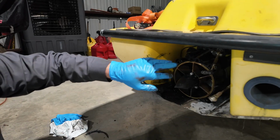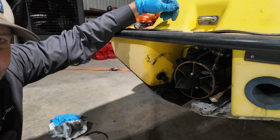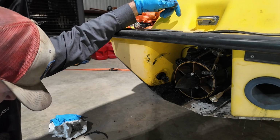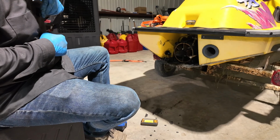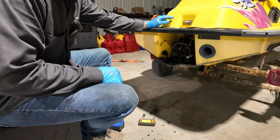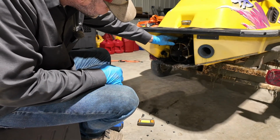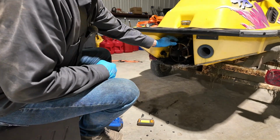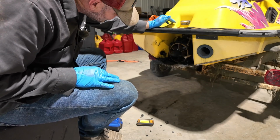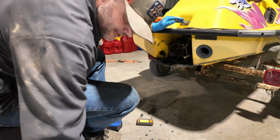I'm gonna go ahead, look at the shaft, make sure it's in the right position, check my 3 hoses, and then just start bolting this thing back down. So give me a minute and I'll reposition the camera. Check the shaft, totally engaged, first shot. Could not believe it. The 3 hoses that hook up to your pump housing right here, I got those tightened up, installed. There's 2 O-rings that go right here between your inner and outer pump housing. You want to go ahead and put those back in before you put the outer one back on.